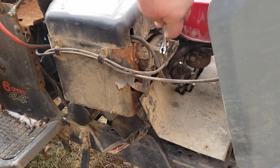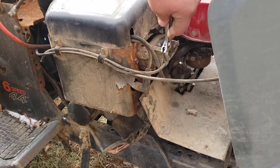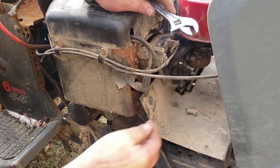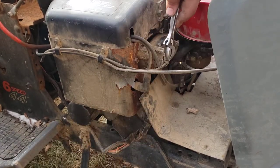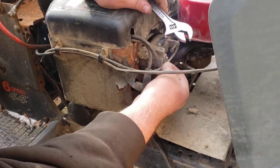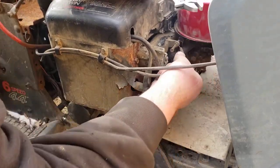You don't have to take this all the way off, just enough to get it to where you can slide that out from underneath and then pop it out. The throttle lever on the carburetor should be able to come out with just a little bit more. The only reason I'm changing this is because this one's seized up and I have a spare one.